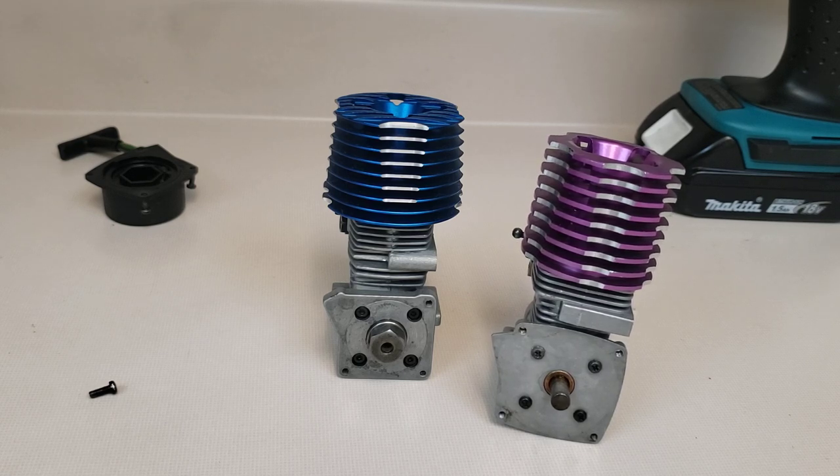That's why a lot of people say Dynamite pull starters are garbage — they're not. Usually the reason they fail is because people overextend them, treating them like a big chainsaw, yanking the crap out of the cord right out of the pull starter housing. The engines are flooded, they get frustrated, yank harder, break the spring or casing, and then blame the manufacturer. It's not the manufacturer's fault. If an engine is hard to turn over with a pull starter, it'll be even harder — and more damaging — with a drill.